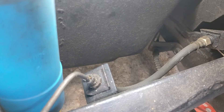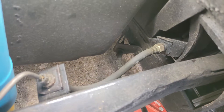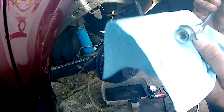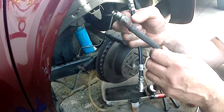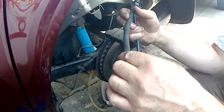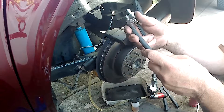Here's the hose on the other side, installed at the same time. You can see there's no corrosion on the outside of that hose, and it flows just like a brand new one. So I'm not going to do anything to that, but if I do ever get any restriction in it, I've got another hose ready to go. This is how easy it should be to blow through one of these lines. So this rust has expanded and constricted the line, maybe the rubber is breaking down. Inside, even though it's a Goodyear hose, it's from 2008 — a 15-year-old hose with corrosion on the inside. Maybe I should have flushed my brake lines more frequently.